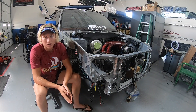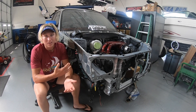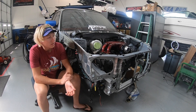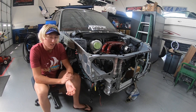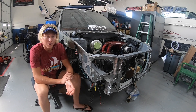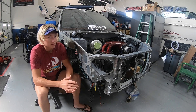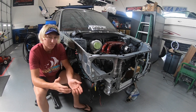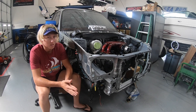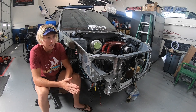What's going on guys, it's Jake. We're back in front of the YouTube video and as you can see we have the turbo on the car — this is the big reveal. We are going to be running a 6466 with a 1.05 exhaust housing, it's a Precision, and hopefully it will do everything we want it to do and push upwards of 700 wheel horsepower. I was talking to the tuner and he told me to possibly consider a 6870, but I decided not to because he said that turbo was a little more radical, and I really just want it to be a street car and have fun with it.